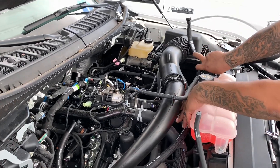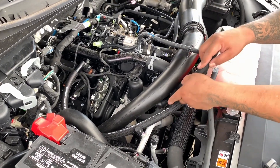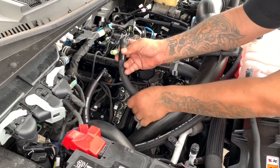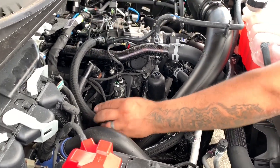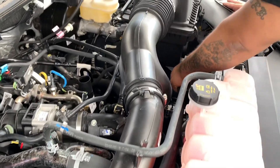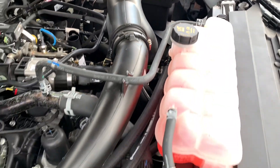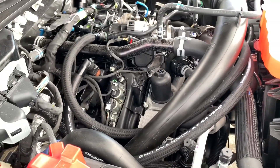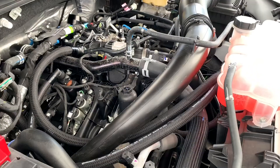Now the clean line — make sure you run it under the intake tube. The other side goes on the can. That line is pulling vacuum until the engine goes into boost, and then the check valve closes off so that we're not pressurizing the crankcase.